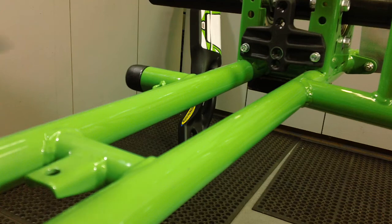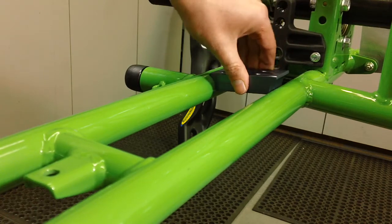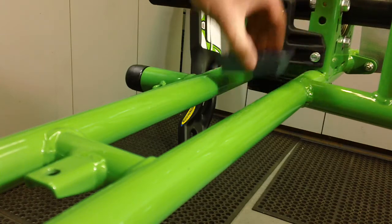I have one butterfly that's too large — as you can see, it's not going to easily drop in between the frame rails. With a lot of chassis you could force it in, but you don't want to because it will stretch the tubing or collapse it.